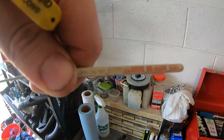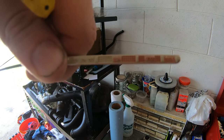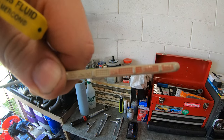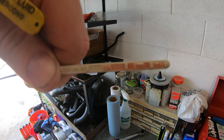Eight quarts is what you'll need for the 4x4 pan — most likely seven with the stock pan since it holds one quart less. Always start with a little less because you can always add more like we did, starting at six and ending at eight. Now that the fluid is topped off, I'll go for a quick drive and let it shift through some gears to show you how it shifts. The video probably won't do it justice but we'll see if we can show what the valve body did.